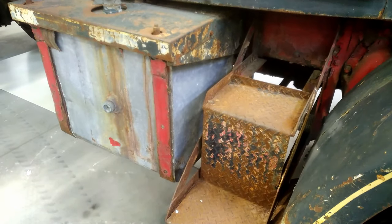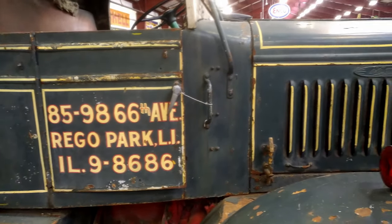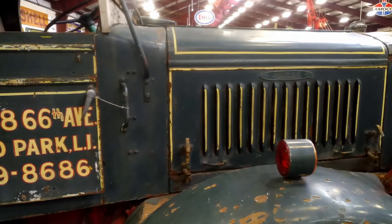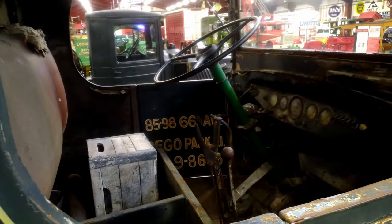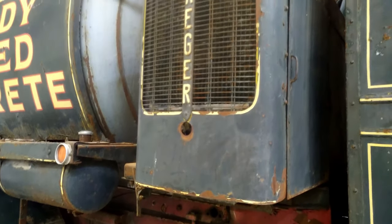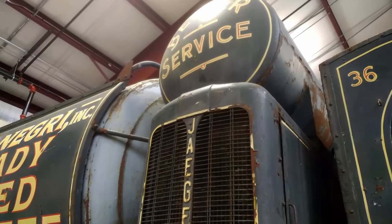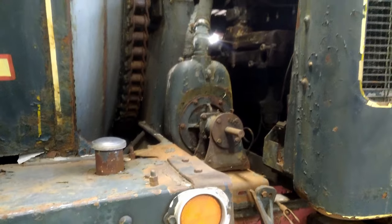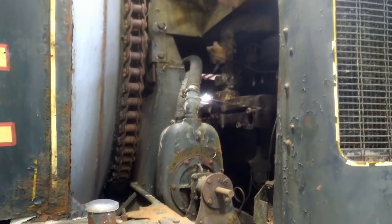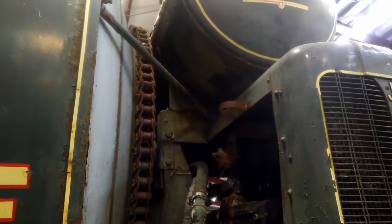The F series is a very heavy-duty truck. They are very desirable among truck collectors. It has air brakes, but is still using chain drive. It has a C-cab design that goes all the way back to the AC model starting in 1916. It has a six-cylinder Mack engine and two Mack transmissions. It is all Mack. This truck weighs over 24,000 pounds, and its GVW is 50,000 pounds.